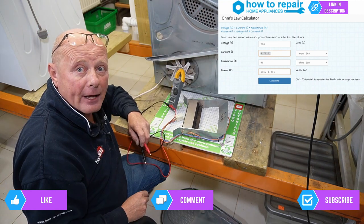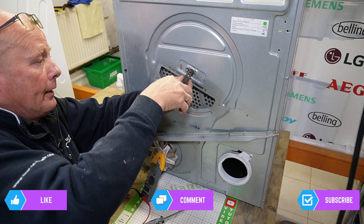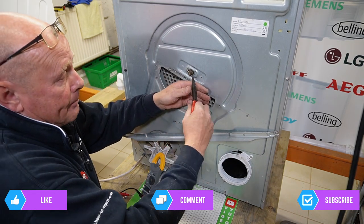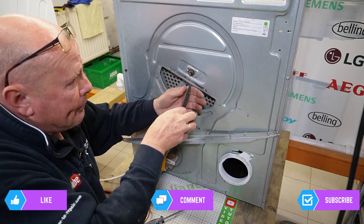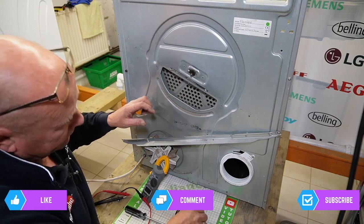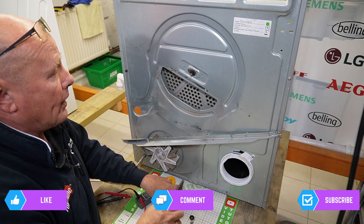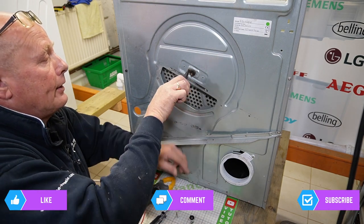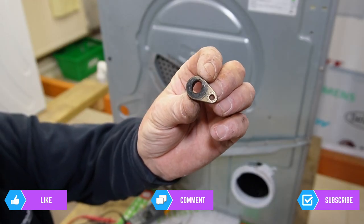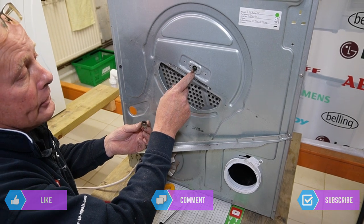We need to replace the back bearing as well, which I'll show you quickly now. It is very important when doing these jobs that you do them right because you'll get many years more use out of the machine. This bearing — I can tell you now by the movement that you saw just now — the roundness of the bearing holder or the shaft is in very bad condition. And what happens with these is they cut through. If you look at the outer cover and I quickly remove the bearing now, we have caught this in perfect timing before it actually did damage to the shaft. You can see that the bearing has created an oval-shaped hole instead of round. That means eventually the shaft would have cut through the bearing and cut into the steel, damaging the shaft.